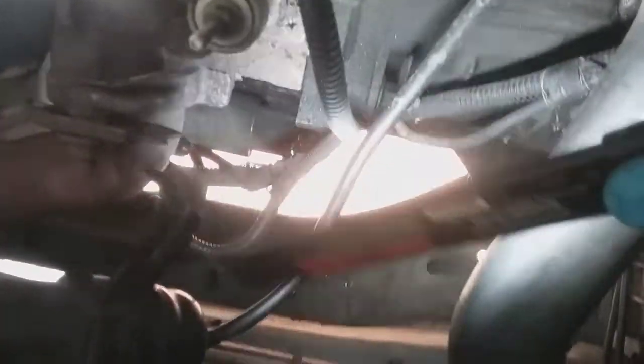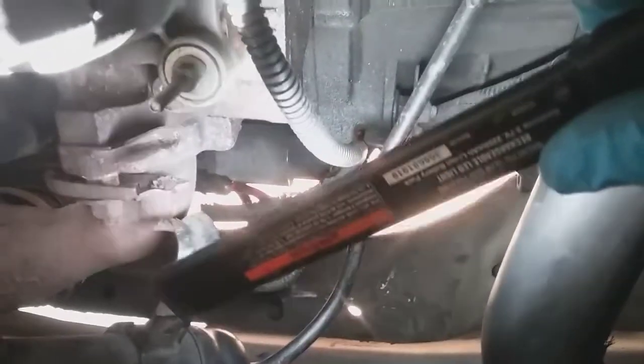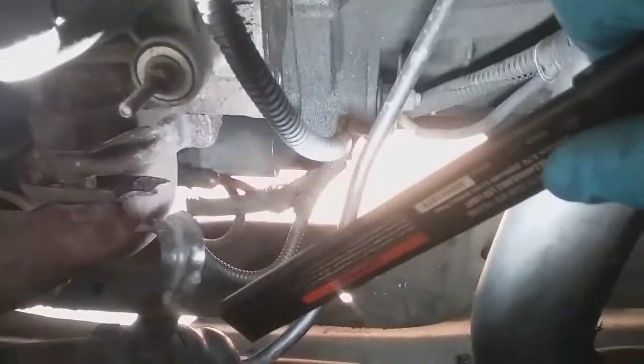So basically, I'm just gonna go from the bottom, pull those two bolts out from the side, and the solenoid and motor wires that are hot wires. Get that pulled out, get the new one in there. We'll retest the circuit. All right, got the starter put on. It's simple, just 13 millimeter and 10 millimeter. Remove the solenoid wire down there.